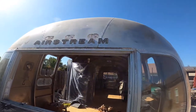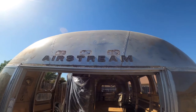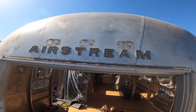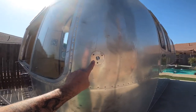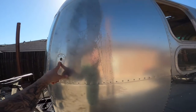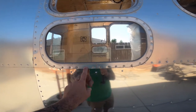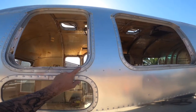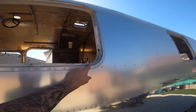We also need to remove these letters up front — it makes the polishing process a lot easier to get into every piece of metal, even in the tight parts of letters like the R's and A's. The spring-loaded antenna is already removed and I have a new one ready to replace it. Here's the other window — when we did the exterior panel we already had to remove these rivets, so we're ahead on this side. We'll remove and reseal these after the polishing process on each side.